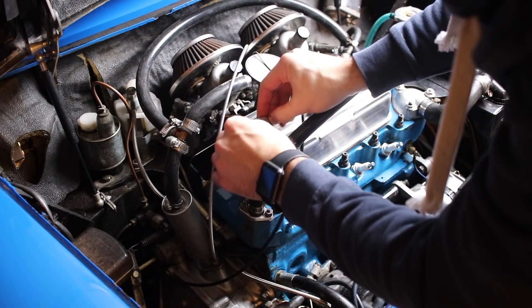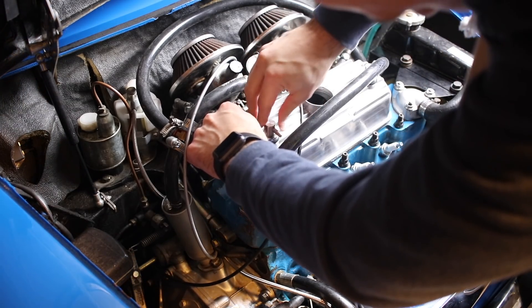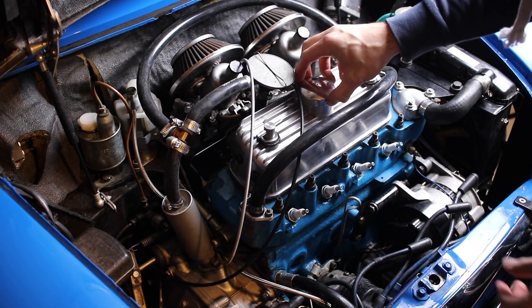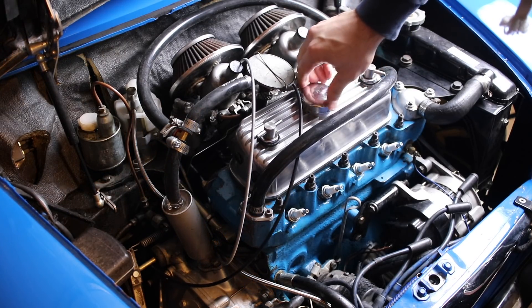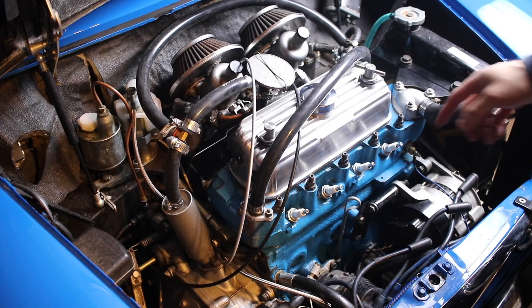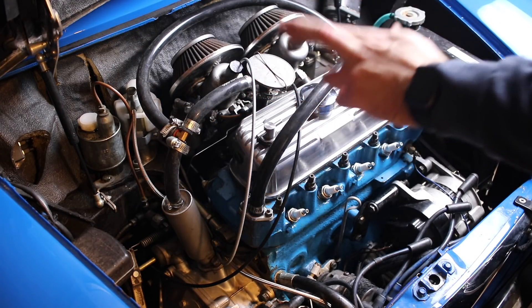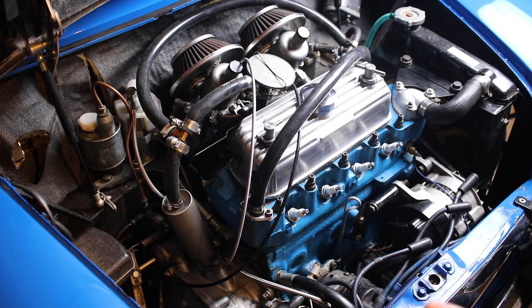As you can see, I'm just tightening these down like normal — nothing fancy about this step. And then, finally, the finishing touch, which in this case is my chrome cover, which never really gets fully tight on there. And then you're done. You've got your valve cover returned, you've got a brand new seal, and hopefully this time it won't leak. But this time, we'll also be checking it after a good drive, after it warms up, to see how it runs.